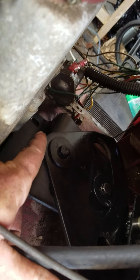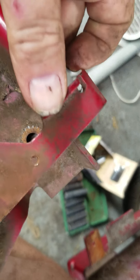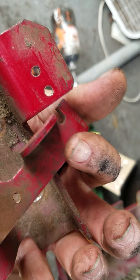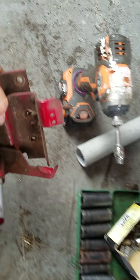You'll have to remount the old switch on the new one. It force-threads itself — self-threading screws, I think they're 5/16ths. When you get it that far, you're just down to doing the four main mount bolts: one, two over there, and then two identical ones in the back. To get to that fourth bolt, you have to turn the power-to-the-blades lever out of the way because it's in the way. You're probably going to have to use a ratchet — you might get away with a subcompact impact wrench on the other ones, but that last one you'll probably need a ratchet.